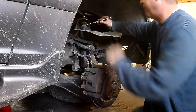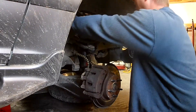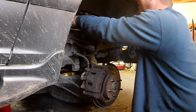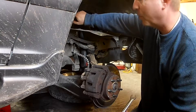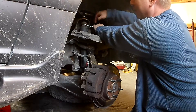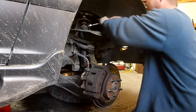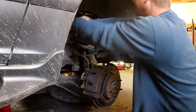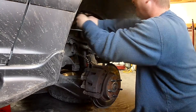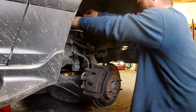All right, we're about to get this off finally. It's been a few minutes rounding the nut, but I got it placed up against the inner fender well right here and it's been bracing and holding. So instead of loosening the nut up there, I've been twisting the shock down here. Pro tip — takes a lot less energy to move one wrench than holding two.